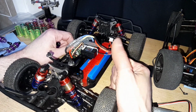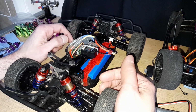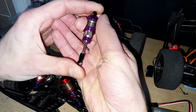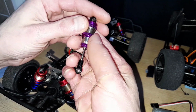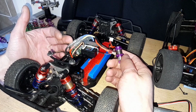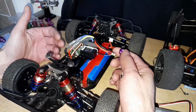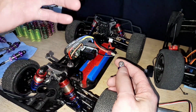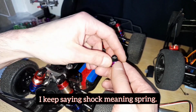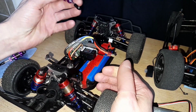Well, first off, I'm going to give myself a thumbs up because I think I've done really well with that one. Anyways, rather than blow my own trumpet, that's obviously rebound there in the shock itself, set with foil, versus no rebound. So in the slow-mo, hopefully you can tell the difference: with no rebound, even the harsh shocks were really jumping off the floor. If you put rebound in your shock, you can tame a really aggressive spring down a little bit by adding some rebound into your shock, because it'll work vice versa.